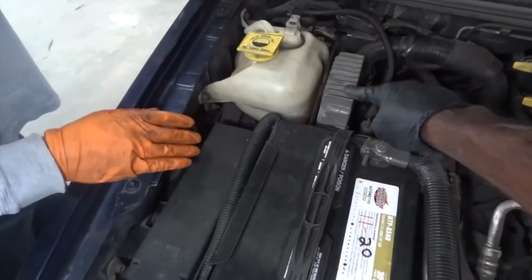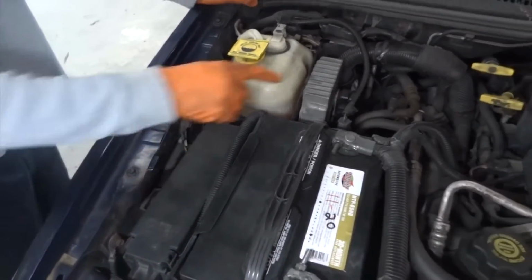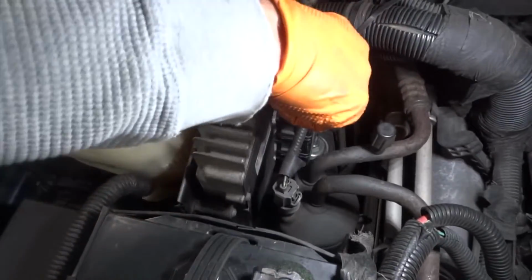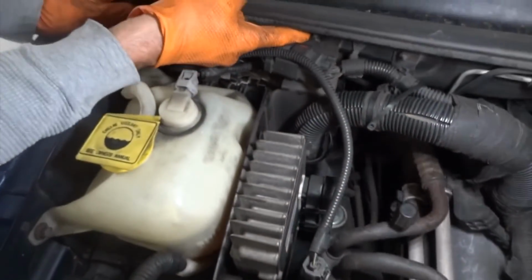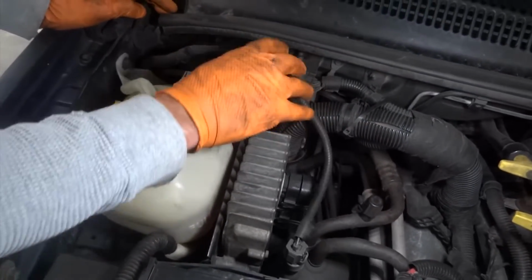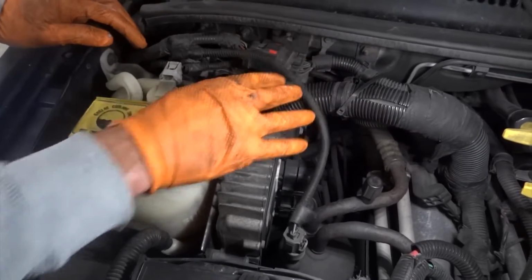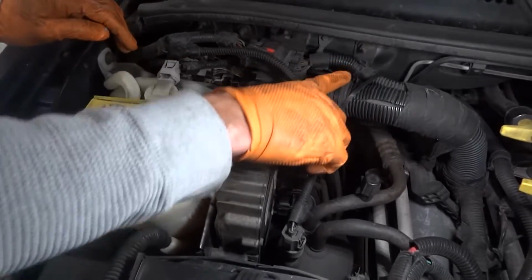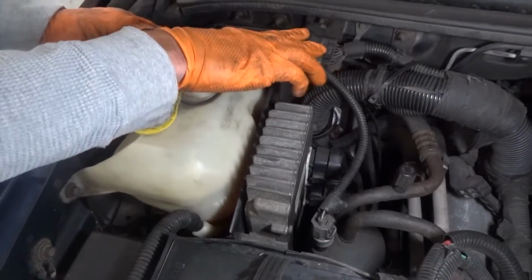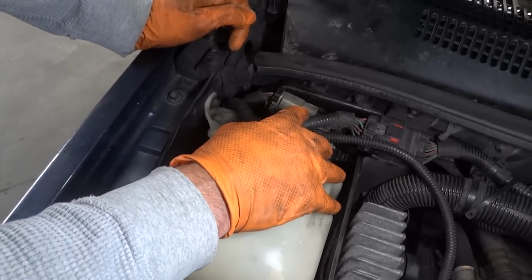Do you know what this is? Is this the transmission computer? Could well be. It comes out with 2 bolts, 2 10 millimeters down there, and it'll come straight out, as well as this 10 millimeter here. Another hint, these connectors that you see here do not need to be pulled apart. They can come with this assembly in this case. So you didn't disconnect them, you just removed the whole bracket. That's correct. This connector can stay, this connector can stay, connected and attached.